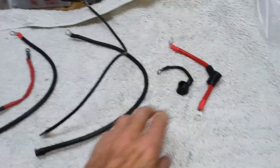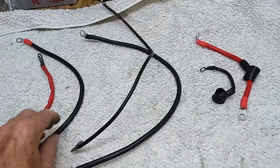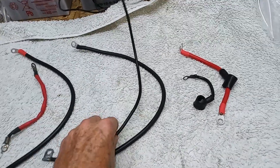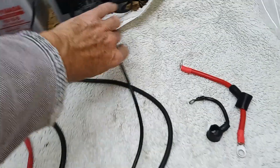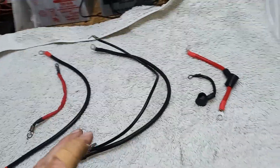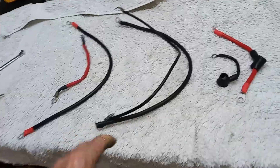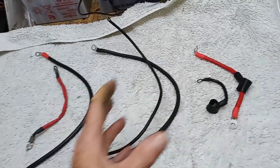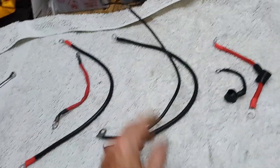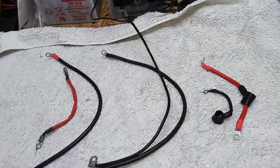That's the same with all the cables — these originals versus the replacement ones. Basically, I really don't know what Triumph would think, because these cables are just too thin to carry a huge amount of current. They're simply not wide enough for loads of current to shoot through, so the cables get very hot and the starter motor doesn't work very well.